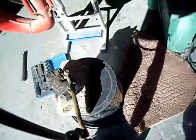So yeah, as you can see, I've just done the same again on the other side of the fork. Just took out the bolts, got to do that set next, and I should have this fork off. But it is important to take the strain off your brake caliper. I don't know if you can see it there, I've rested it on a bucket and a brick, because you don't want strain on this pipe.